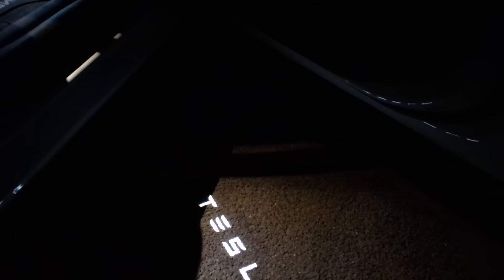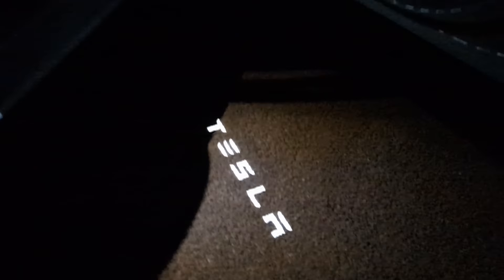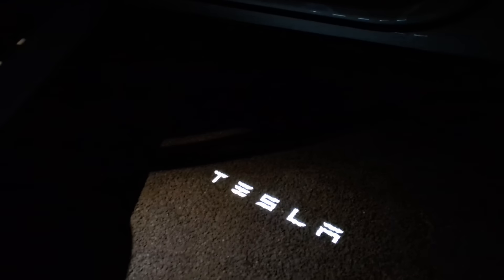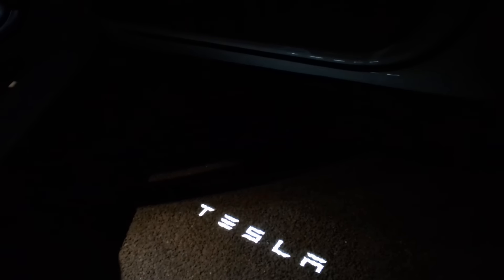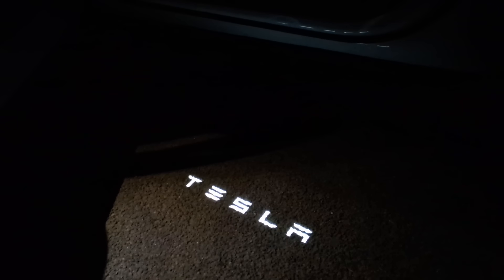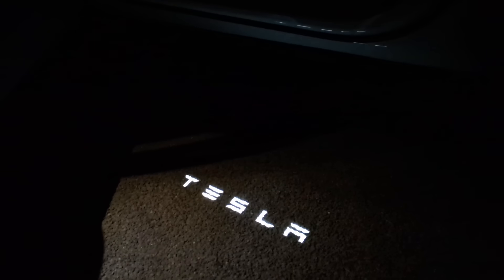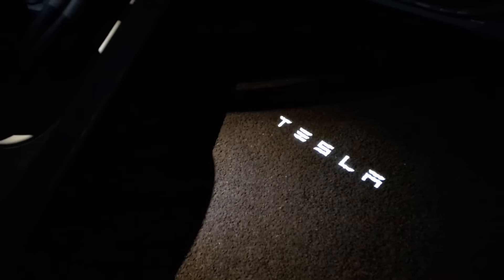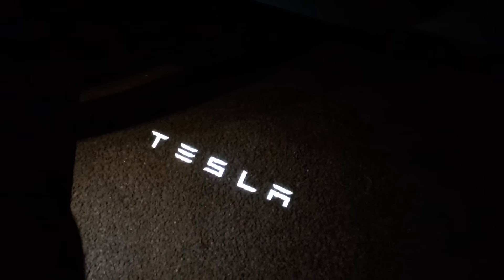It reminds you what sort of car you're getting into — your kids will certainly like them, or if you're a big kid yourself then go ahead and get them. I had actually fitted the driver's door puddle light the wrong way round — the key wasn't fully in the slot and it wasn't quite clicked home. Now it's the right way round, projecting Tesla so you can read it when you open the door, just like on the passenger side. I'll leave my mistake in the video because it highlights that you can push the light in the wrong way even though it's keyed — it needed to sit home another three millimeters and I didn't have my glasses on.